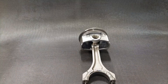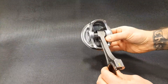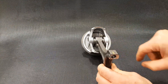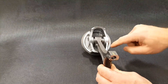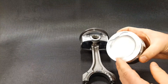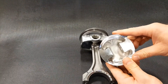Once we have our pistons out we're going to do an inspection. A couple of things to note about the Toyota pistons we're looking at here — these are cast hyper eutectic pistons. Cast refers to the manufacturing process, and if we look underneath you can actually visually identify these as cast by the casting marks. These lines and the waffle pattern underneath are from the mold they were cast in. The alternative of course is forging, and if we have a look at a forged piston on the bottom side there's no evidence of any casting marks.